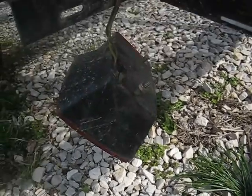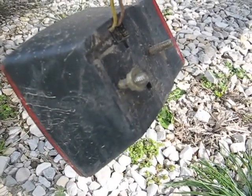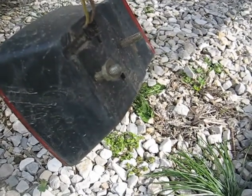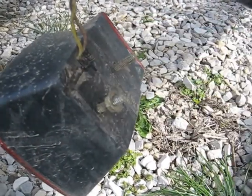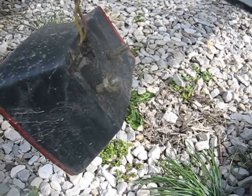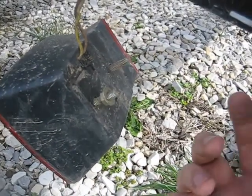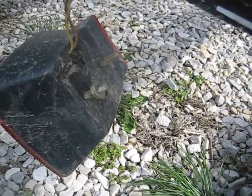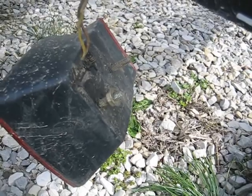Today's video is about trailer light repair. The repair got more extensive because there's bare wire showing. We need to open up the fixture, lift the copper tabs, push the wire back through, and release the tabs to grab the wire. The second part of the fix involves tightening the metal bracket that holds the light bulb end, which is held by two bolts on the back. We'll fix the wire first, then tighten the bolts and bracket, then test it.